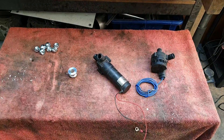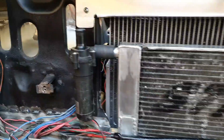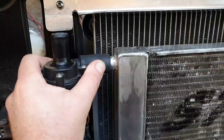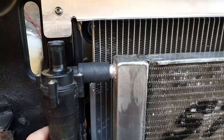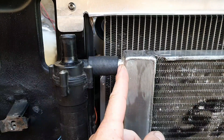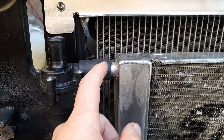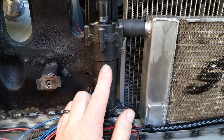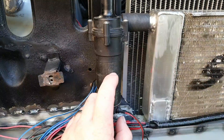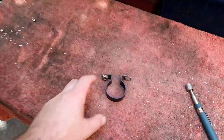I think at the moment, given how long we could be in lockdown, I'm probably going to press ahead and do that. So there we go - that was pretty easy. I just removed the fitting that was on there, made a new fitting up, put that on. Hose is now the same size both sides - 17.5mm hole through the centre of a 20mm diameter bar, giving us a relatively thin wall tube with big bore flow. So the next thing to do was to get the bracket for this pump. The original installation in the Sylvia had a bracket for that - it was pretty manky looking. I just took it all off and chucked it in the box to deal with it later on.